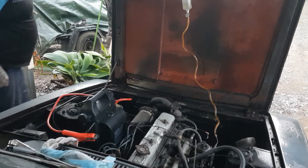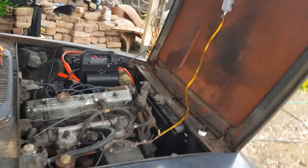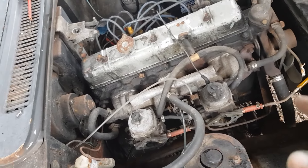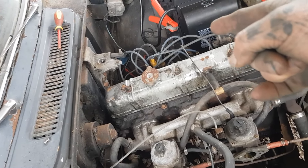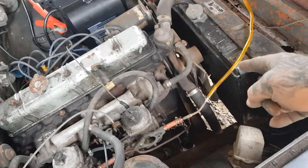We'll tidy up the steering wheel — make all that look nice, just give it a good clean. So just clean it all — carpet, tartan, clean all the leather. The interior should look good. We'll make the interior look very presentable on a very cheap budget. In the engine bay, we're probably going to have to rebuild these carbs because it will only run with the choke. So we'll rebuild those carbs, give it a full service — oil change, oil filter, new points, probably a new dizzy cap, maybe new leads, and plugs — we'll definitely need plugs. New coolant, all of that malarkey. We'll make sure we get the fuel filter working.